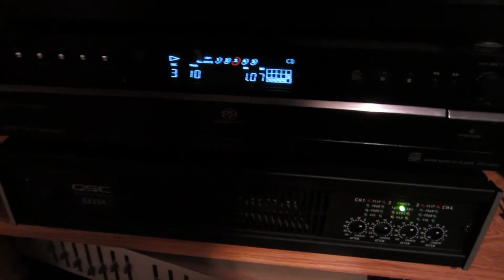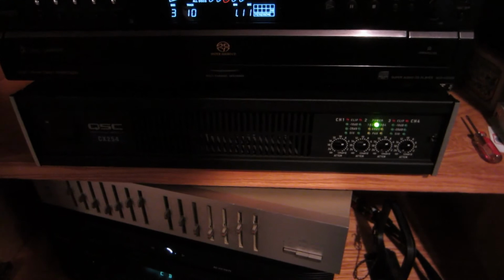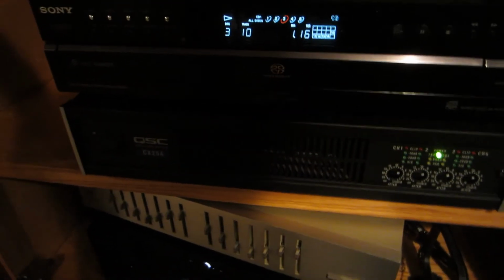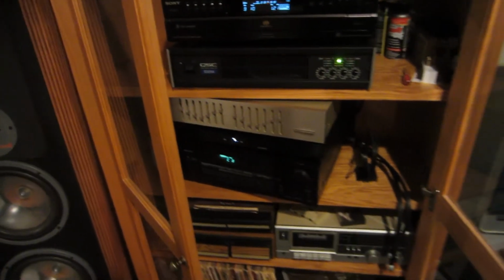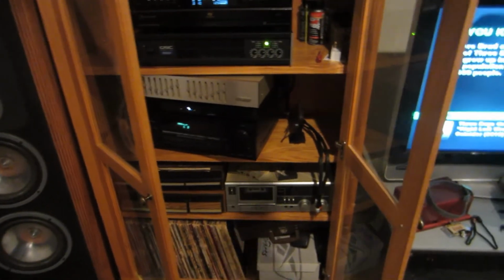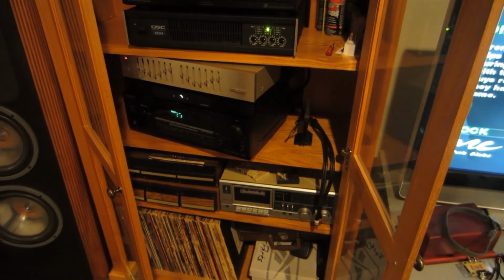I noticed that it was getting hot, because it's only running the top end. And my Pro Amp up here is basically doing nothing. I'm checking to see if it's even on. The fan may be broken or something, because there's nothing coming out of it. So, to make a long story short, I switched everything around. I made the Pro Amp run the whole top end and the receiver run the bottom end, and of course the receiver is running cool as a cucumber.